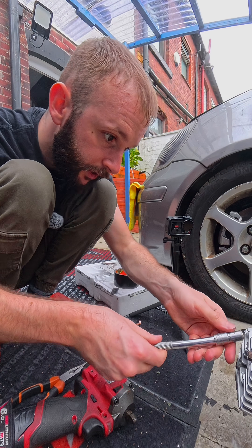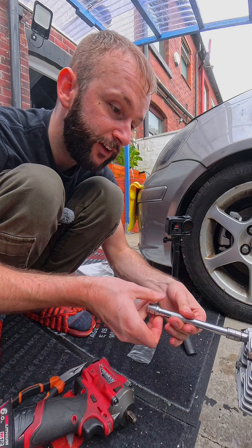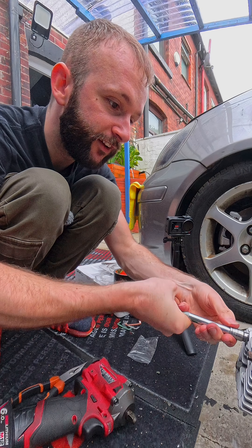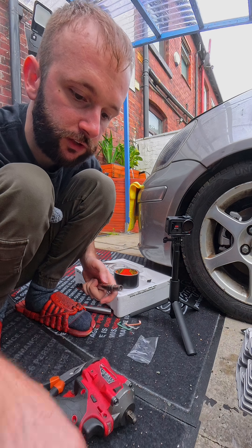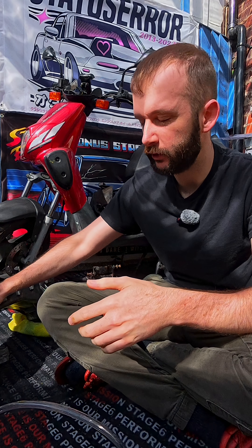That's crazy. New nuts, new studs, new cylinder kit, new crank, new bearings — everything's installed correctly, operating smoothly, the clearance is set. This is good. Now the last thing is just getting the reed valves in and the new intake manifold that we've got. It's been about 14 hours since we put the engine together, so the Honda bond is time to set.